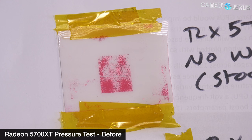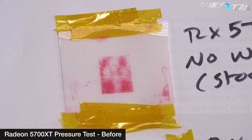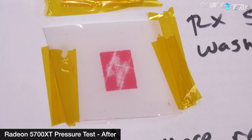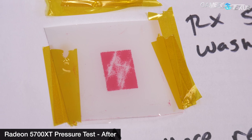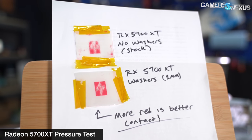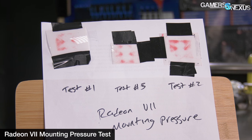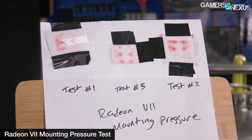While this shot of the pressure paper is on the screen — if it's a brighter or more saturated red, that means there's better contact in that area. If it's not red or it's not quite as saturated, that means there's worse contact. We see a gap exists in the center for both tests, even with the washers, which would indicate one of two things: either a lack of mounting pressure in the center of the cooler, which makes sense because there's no screw there since the GPU is there, or it could also mean that there is a bump in the surface of the vapor chamber — a non-levelness, which would also make sense for a vapor chamber. In our original Radeon 7 testing, you can see how there's a similar pattern that emerges, and we think that is probably from where the vapor chamber might have some cylinders or different support — it's a levelness issue in the cold plate.